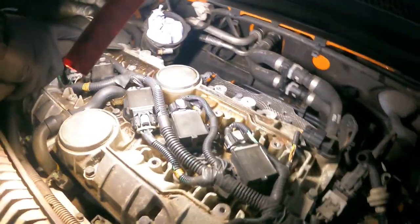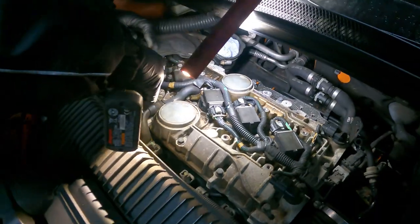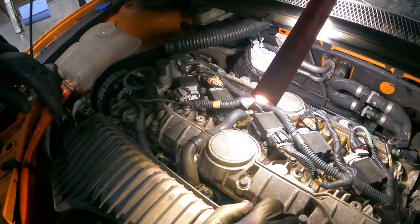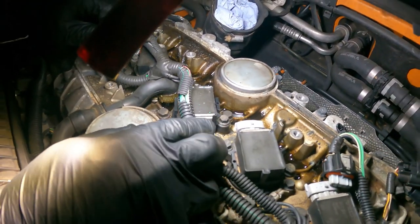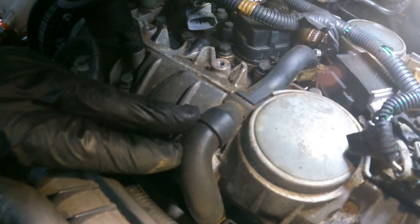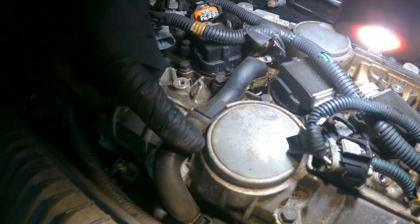It's got an oil leak going on on top. While we've just been chatting and undone the loom, we've realized there's an oil leak — it's all over the top. Not sure exactly where it's coming from because that's fastened on. Chances are it will be the breather kit. On some of the earlier versions they were plastic and they cracked over time or got baggy on the connection. We know this has been replaced at some point because it's rubber and it's got a nice new sticker on it down there.